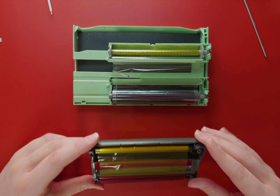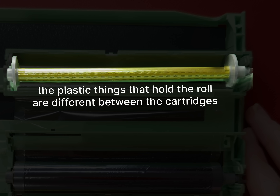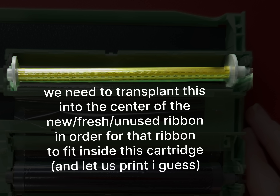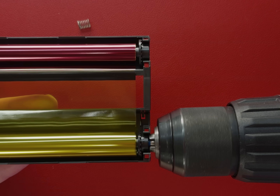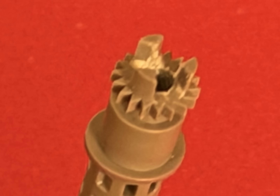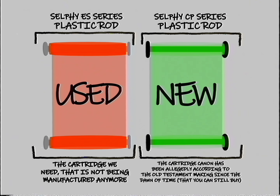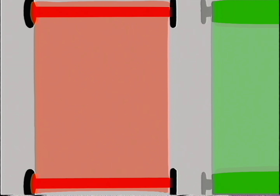My plan is simple: the Selfie printers have no microchips in the cartridges, so I should just be able to put the new roll inside the old case. But the plastic rod here is differently shaped, so I have to unspool both sides, remove the rod from the new cartridge, and put in the one from the old one. That sounds like a job for my friend Parkside. Small disclaimer: this was a very bad idea — use something less powerful like an electric screwdriver, or stuff will happen. So: we have two rolls, one used and one new, and two plastic rods. Even though the actual dye ribbon is identical, the two pairs of rods are different.